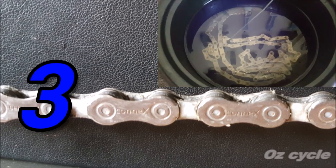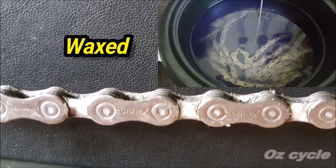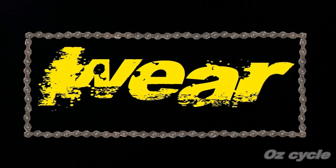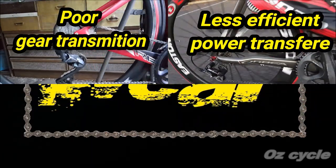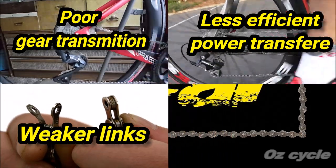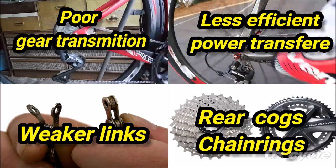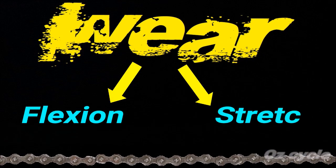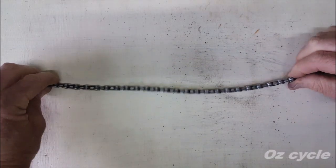This chain has been thoroughly waxed and looks nice and clean — that's because dirt does not readily stick to a waxed surface, and the internal moving parts are well lubricated, minimizing wear. But no matter what, chain wear cannot be avoided. It causes poor gear transmission, is less efficient at transferring power, makes chain links weaker and can cause breakage, and puts unnecessary wear on your rear cogs and front chain rings. Your chain wears in two ways: flexion and stretch. Flexion is the lateral or sideways movement of a chain — it's often called play or slop.